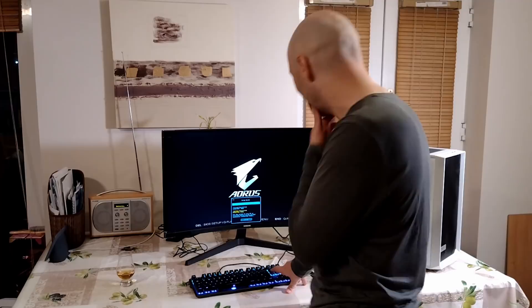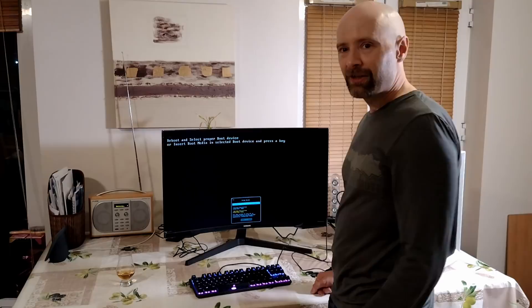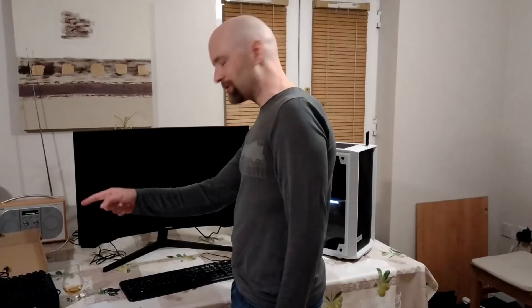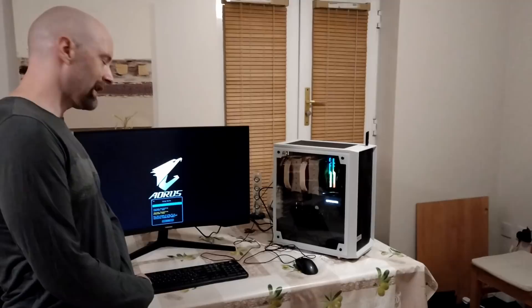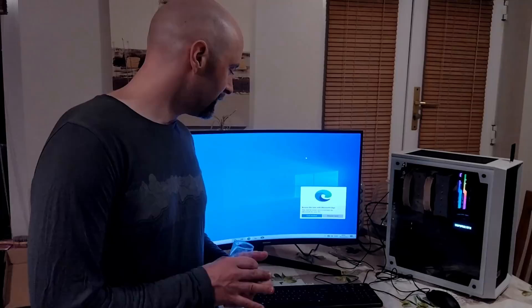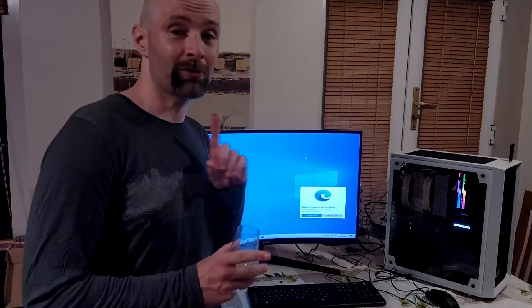There's no F12 key — how do I get into the boot menu? I'm going to go get a USB boot key, a Windows boot USB key. I went and got my old keyboard just so it has an F12 key so I can hit it — that new one does not come with an F12, you have to hit an FN key. Now we can just go to the BIOS and change the boot device. After getting my old keyboard out of storage, we installed Windows. USB key, keyboard, done. Problem solved. Windows installed.